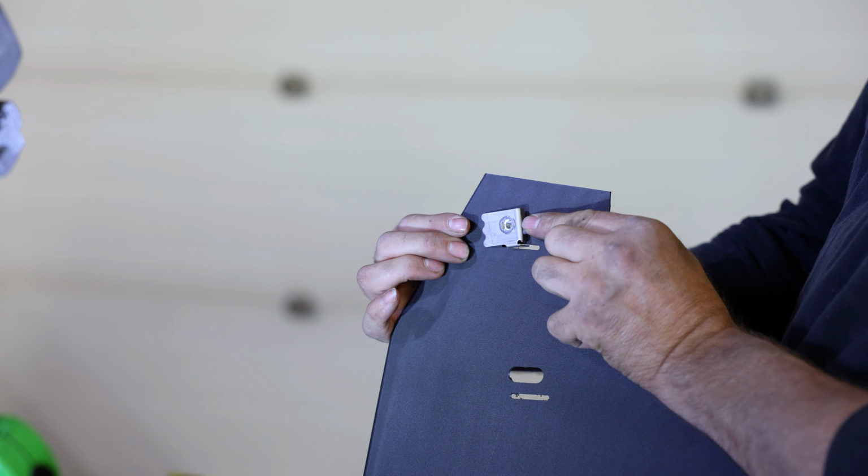Now let's start attaching the flap onto the vehicle. Attach the hole here to the factory hole circled here using a sheet metal screw and a flat washer. When you do this, position the mounting clips you installed earlier behind the fender lip. An example of how the clips should sit can be seen in the following footage. Once in place, loosely tighten the clips. Make sure the J-clamp is positioned like seen here, so that it puts pressure onto this area of the mud flap, holding it tight against the wheel well.